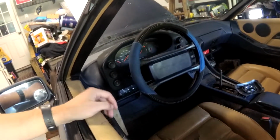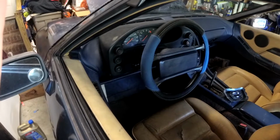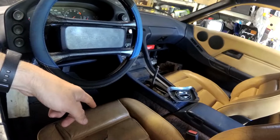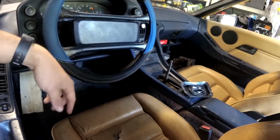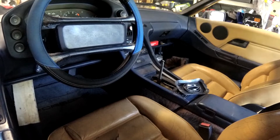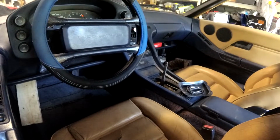Well, this is where I'd like to tell you that everything has been great and the car drives like a dream and no problems. Well, that's not completely true. The car does drive really good now. But I've noticed that when the clutch is engaged, or the pedal's up, and sitting in neutral, you could hear a good bit of noise from the center of the car, sounding like it's from the torque tube. I was like, okay, that's a little weird, and when you put the clutch in, you can hear the drive shaft spin down and the noise stops. Now driving it in gear, you're not hearing anything, so I wasn't really sure what it was at first.